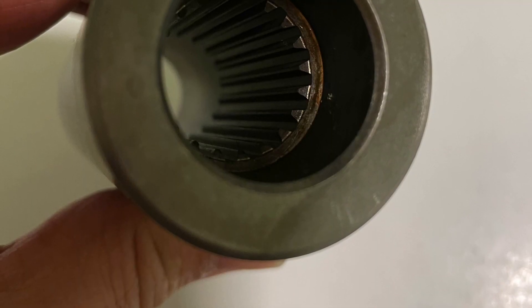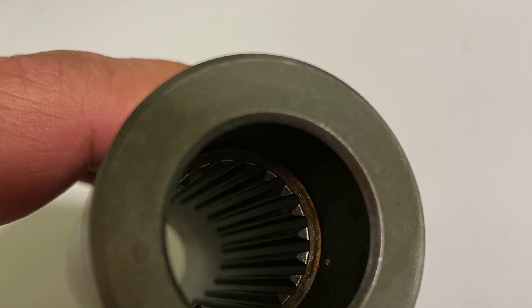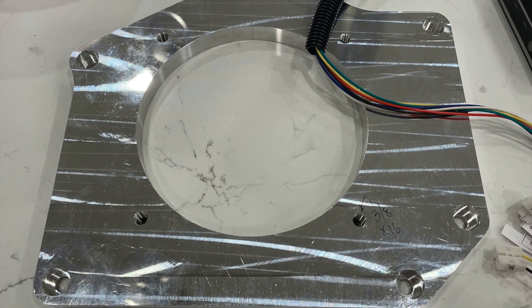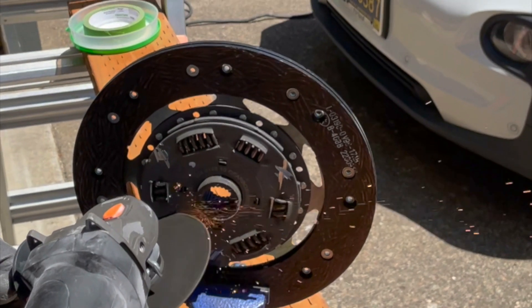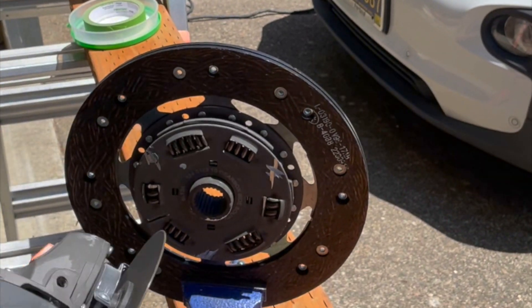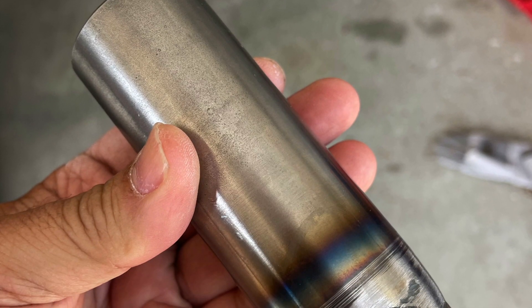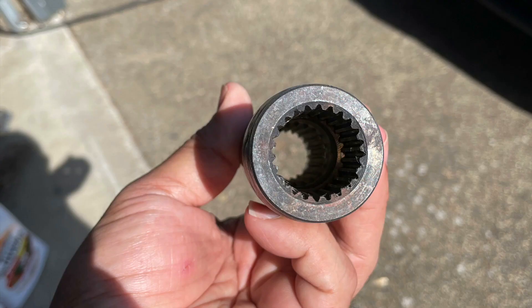The next thing I acquired was a drive shaft coupler and adapter plate from BRAP Industries. I bought a slightly off-spec coupler so my cost for both was about $400 US; the price for both now is about $500 US. These guys are located in Canada. I bought a cheap clutch plate from my local parts store and cut out the center hub so it could be welded onto the drive coupler. It was very hard to find a machine shop that would do this — it took a while but I found a guy who would do the work for $110. If you are in Oregon, I recommend Steve's Machining in Cornelius, Oregon.